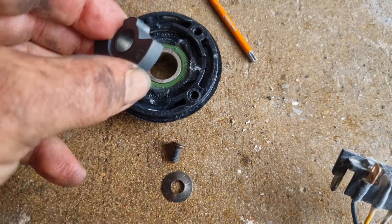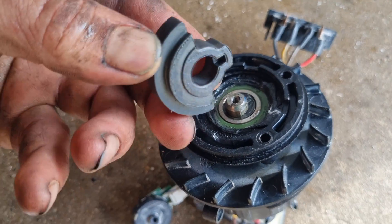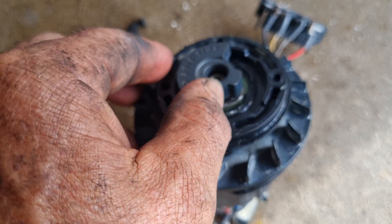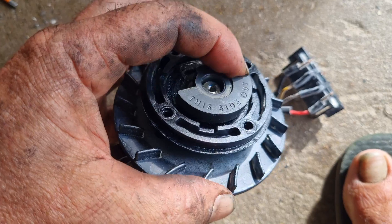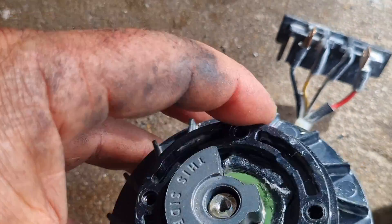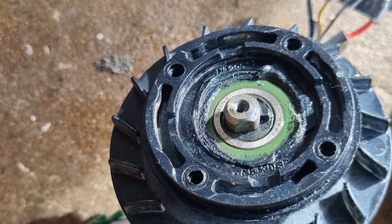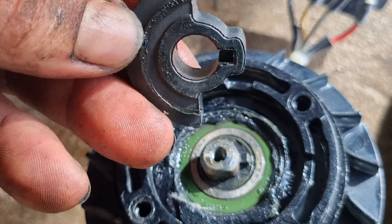This unit sits on here and this sits in here. There's a counterweight that creates the oscillations in the circle, in the sanding. But what's actually happened is as it goes round it's actually melted and got hot. So what that has caused — as it goes round it's melted the plastic into a locking position. It's locking in there so the whole thing is spinning. So I'm going to have to sand that melted piece there because the bearing got hot and melted that plastic. I'm going to smooth this ridge of melted plastic off back to smooth so this can spin freely around its axis.